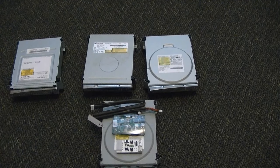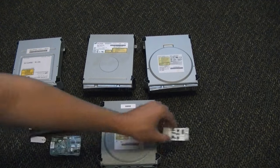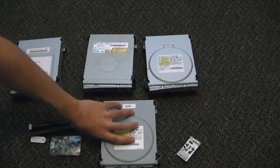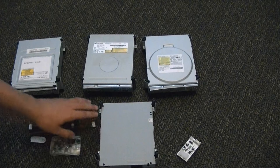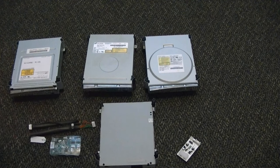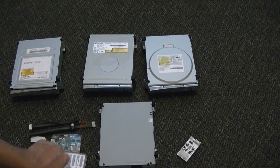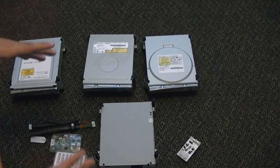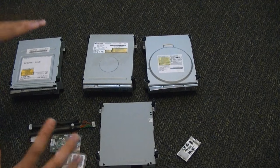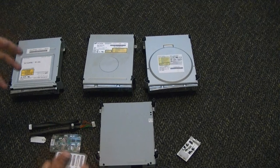So you will need one of those. The final thing for a LiteOn drive — in order to get into it, this is the only drive you need to do this for. If you have a LiteOn drive, you're going to have to flip it over at one point when pulling the drive key off and unscrew the four Phillips-head screws on there. So you will need a small Phillips-head screwdriver. None of these drives require any soldering or anything really hard — so don't worry about that.